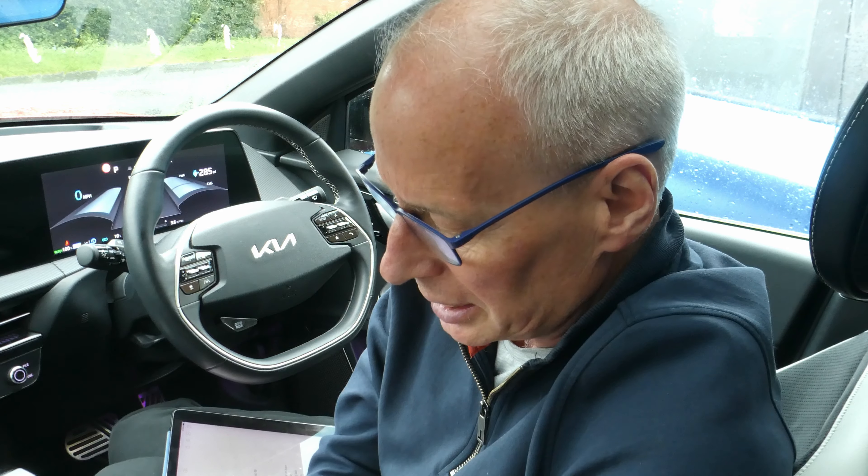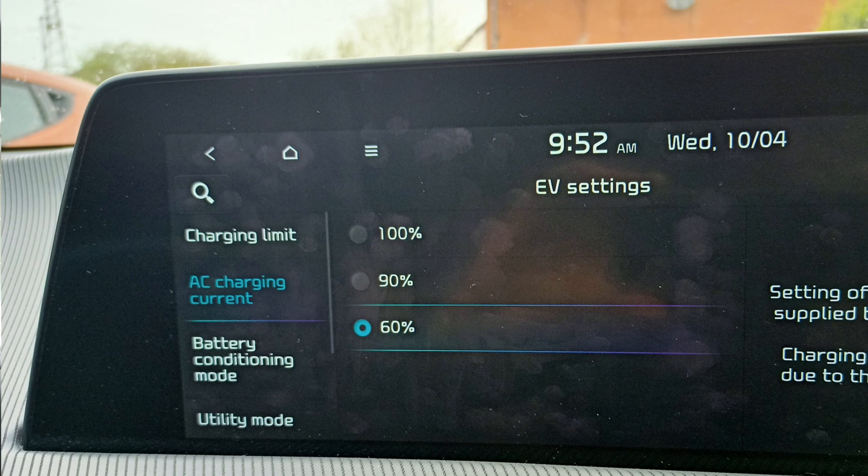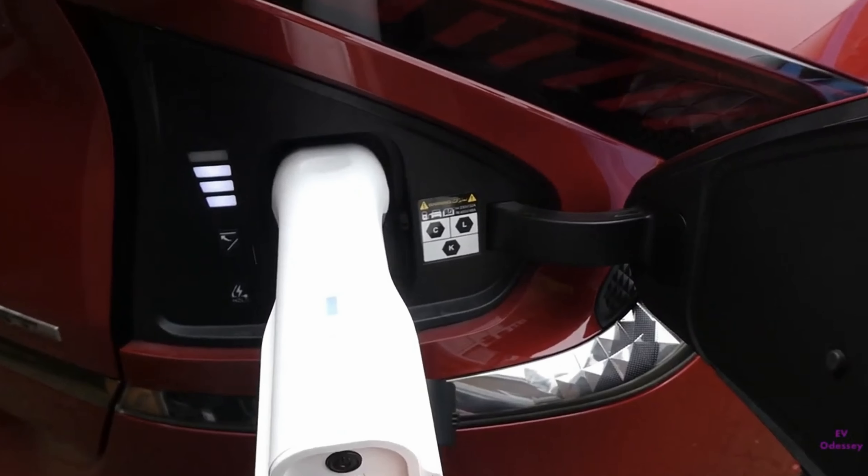I find that strange — I'm a regular vehicle-to-load user and I've never had a problem in the two and a bit years I've had this car. In conclusion, the graphs show that the lower the current you charge the car with, the lower the impact on the low voltage DC converter. Vehicle-to-load gives the highest temperature I've seen on the LDC, but because it's a slow build-up it may have less of an impact on ICCU failures. Anyway, I hope you find this useful — thank you for watching.